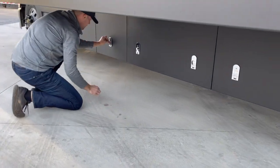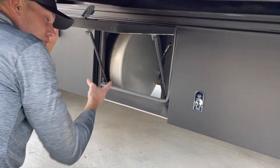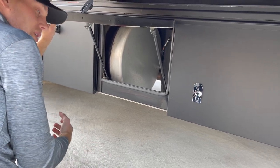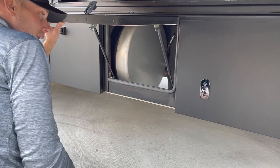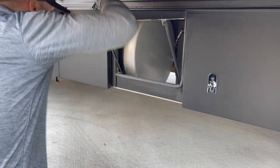The next compartment has an air outlet. You can get a little hose and an air chuck — if you need to air something up or need air pressure, it uses the compressor off the coach engine. These coaches have onboard tanks for the brakes and you can tie into that to blow something off or air a tire up.